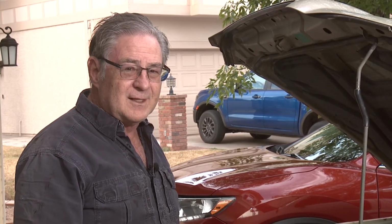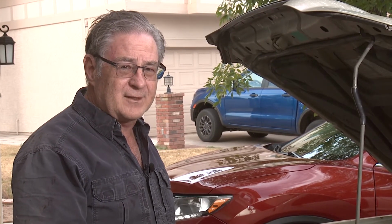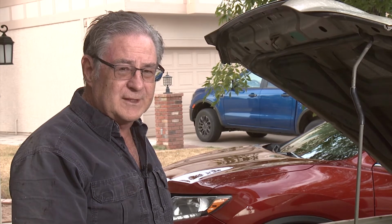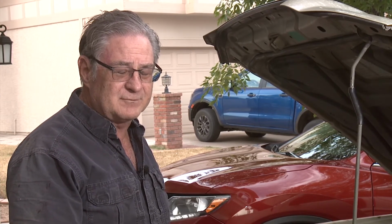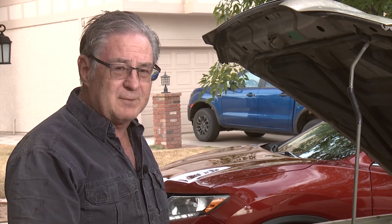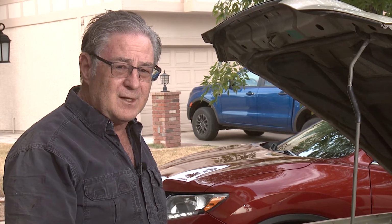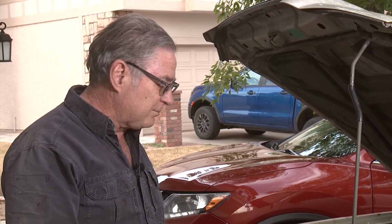So now that we've got the pulleys all on, we showed you an easier way to do it by pulling the pulleys off when you take the brackets off. We put them back on, we've got the pulleys on. So before we tighten everything up, we've got to put the fan belts on. Now clearly, if you're not replacing the pulleys, this is just how you replace the fan belts. You loosen up the outer nut on the pulley, then you do the adjustment screw to loosen it up and bring it down so you have some slack in your fan belt, and then you take the old fan belt off and put the new one on. So we're going to go ahead and put the new ones on. Clearly, if you're replacing your tensioners, you're going to want to put on brand new belts at the same time.